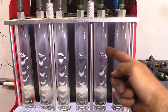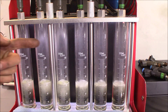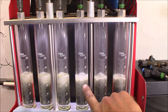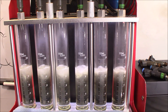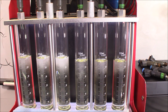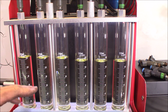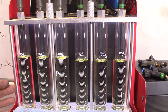You can see how wet the tube walls are — it's just like washing the sides of these tubes. The other ones look more like a fog. Watch as they start filling up — see how they're stirring up, almost streaming down at the bottom, really pushing out a lot of pressure. But these have got more of a mist; it's more atomized. They did use a little bit more fuel in the same amount of time, but these would be perfectly fine on a stock engine. The computer is going to calibrate properly for the fuel it requires, so it won't run rich. If anything, it's going to get better gas mileage.